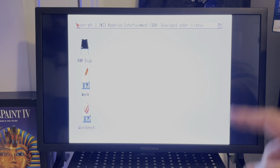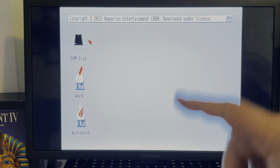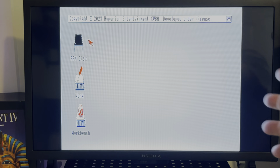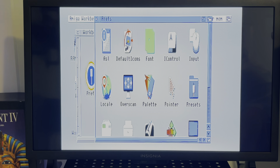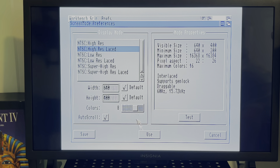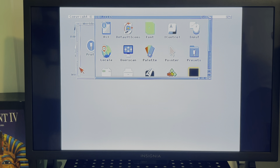It is working out of the box — fantastic! However, I'm seeing some weird squiggly noise going on, which means we're going to have to click the buttons and do some auto-calibration. After using the auto-calibration that the software offers in the menu system, accessed through the little button on the side — boom! We have a rock-solid, beautiful, gorgeous 640-by-200 high-res screen. But who wants 640 by 200? We want the full high-res interlaced Amiga screen, even on an Amiga 600. Keep it in eight-color mode for now, click Use — the RGB-to-HDMI handles it like a rock star. That looks fantastic!